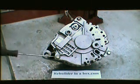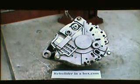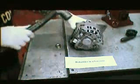Taking one apart, we're going to start by finding the three bolts with the 5/16 head and remove them. Taking the pulley off, we're going to use a half-inch impact with a 15/16 socket. Hold a rag around the pulley. Now we're going to want to take this lid off.